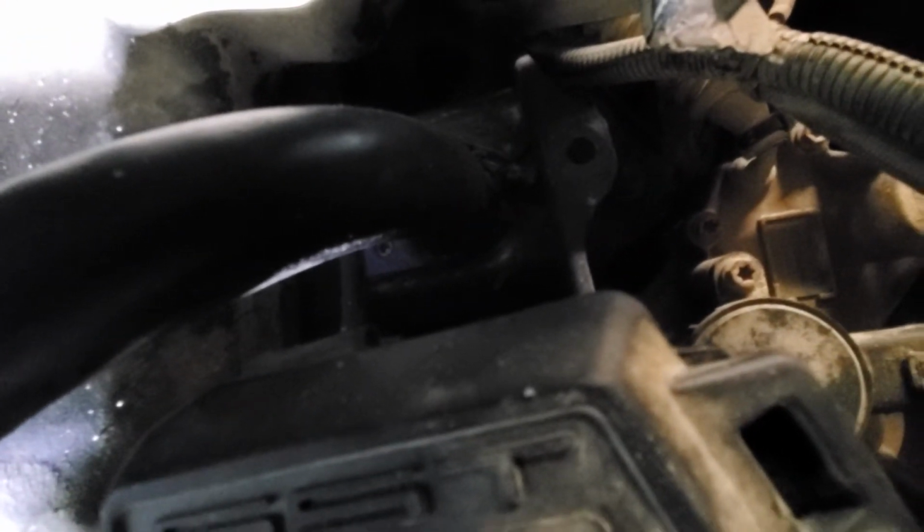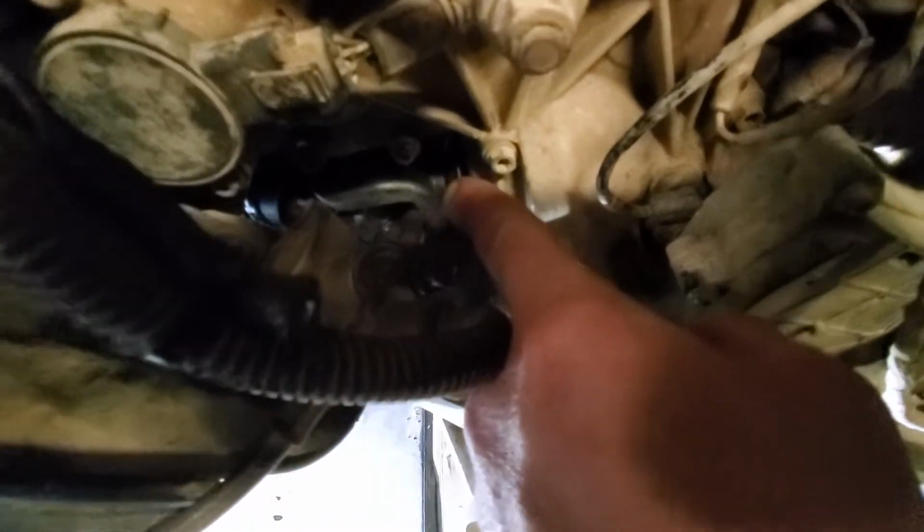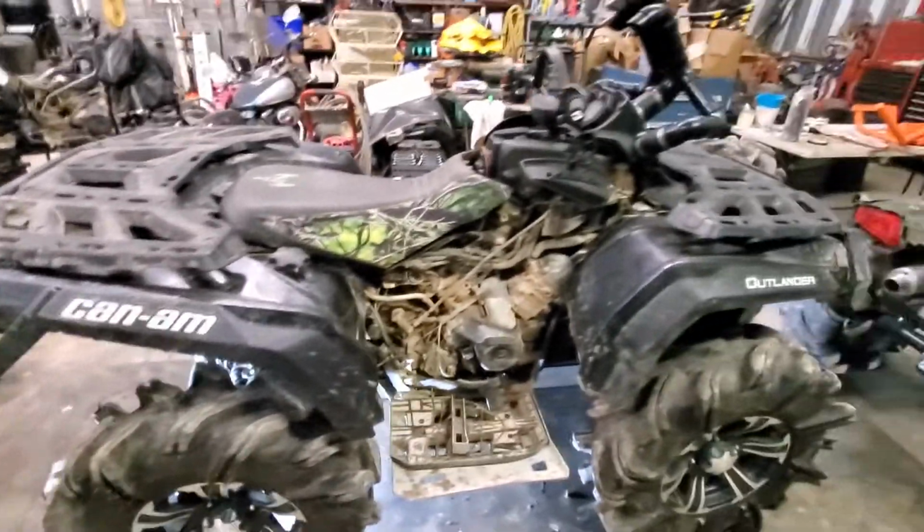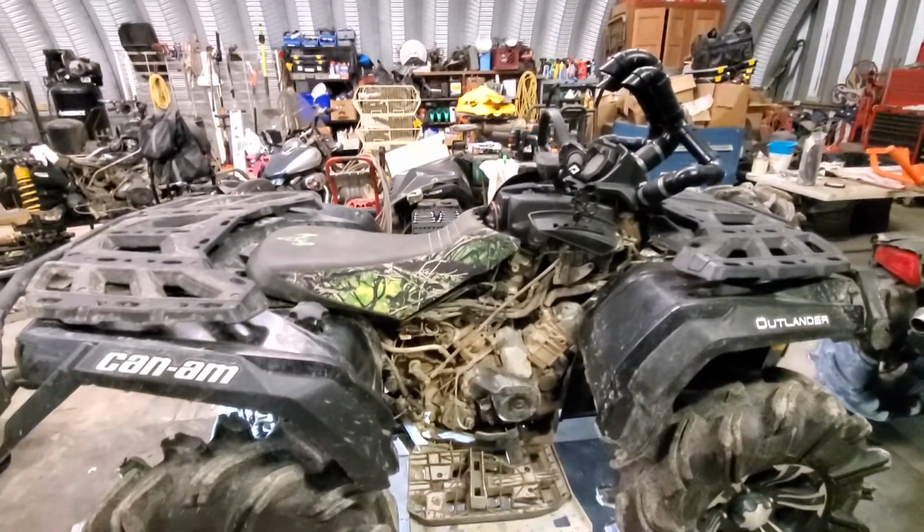And Garage Products, those bushings, and this bushing here definitely help with that noise in the back, that popping noise, if y'all ever have an issue with that. I'm sure you will at some point. But this is all tight. I made sure that was tight, but that's what you got to swap out right there, the one that the XT had on the drive shaft. So, well, look, guys, that's about it on the Outlander right now.